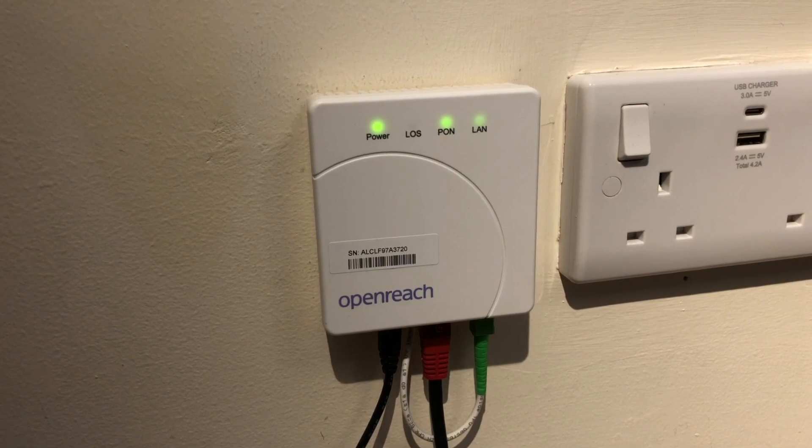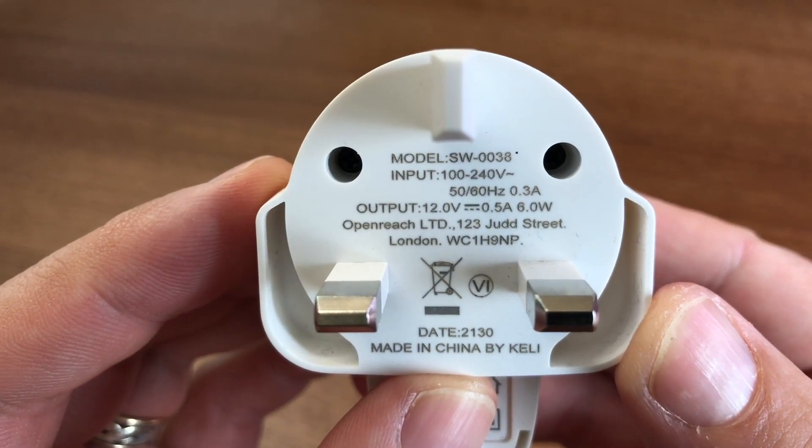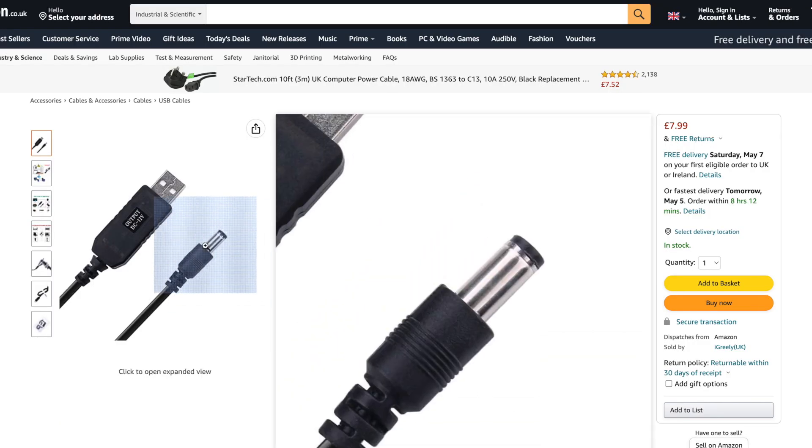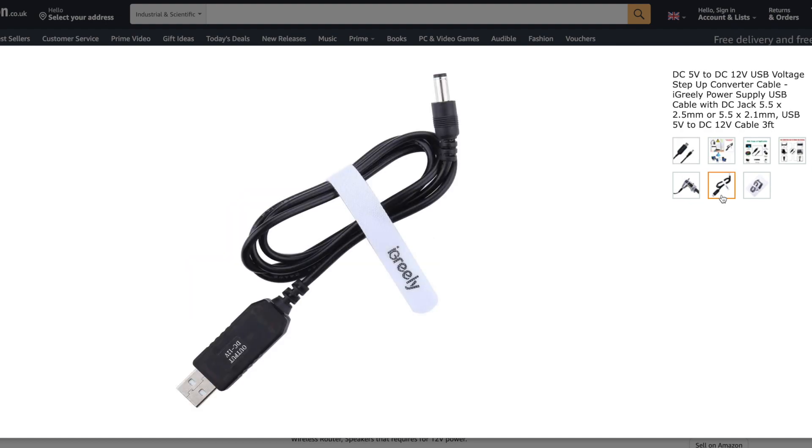In the meantime, I then had to solve the second part of the puzzle. I also have an Openreach fibre ONT modem to keep alive during a power cut if I actually want my internet connection to stay up and running. The ONT uses a 12V 0.5A power supply, but I didn't want to buy two UPSs to keep both devices running — firstly, that's expensive, and secondly, well, that's expensive. After scratching my head for a while, I noticed an unused USB port on the back of my Asus router and thought USB ports provide power. A USB port only outputs at 5V, so I'd need some sort of adapter. I found one that plugs into a USB port, converts the voltage to 12V, and allows a maximum current draw of 0.6A. With that narrow margin, I wasn't confident it was going to work, but I took the risk and ordered the cable anyway.